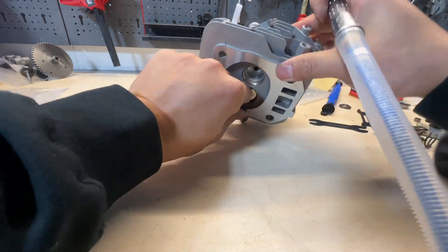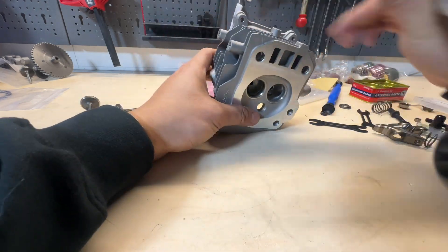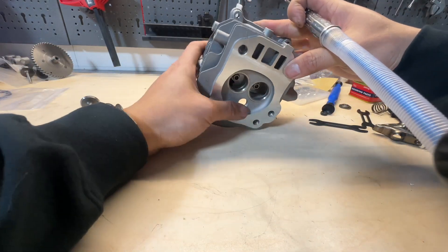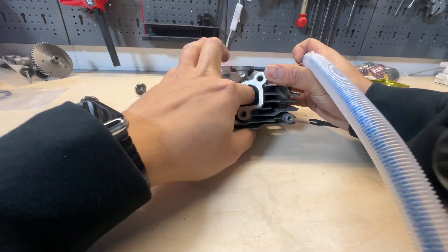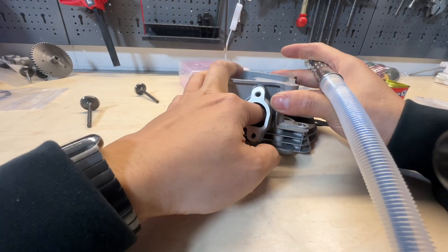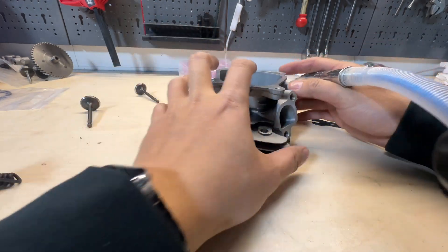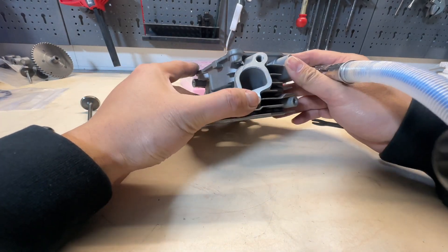Still a step here — just smoothing out the sharp edges. Using your finger to tell if it's a smooth transition is very important. As long as you don't damage the valve seat, it's okay — you don't want to damage that part or you're going to have a lot of problems with the seal. Everything feels very smooth now. I've just gone over it once and I'm going to smooth out the lip as well so it's not jagged. I might need to do some port matching but it looks okay for now.